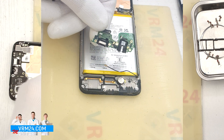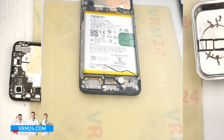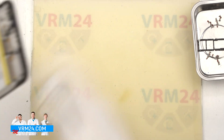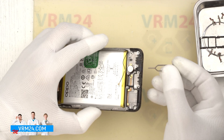On the subboard we have the charging port, microphone, headset port and other elements on the back side. Traditionally we do a quick test of the microphone hole. The microphone hole has an L-shape located in the display frame.